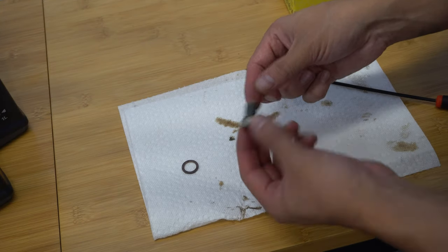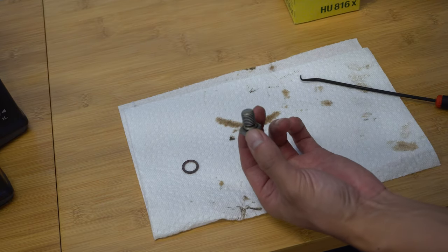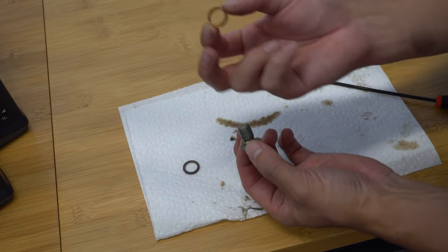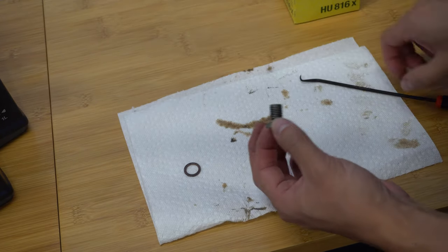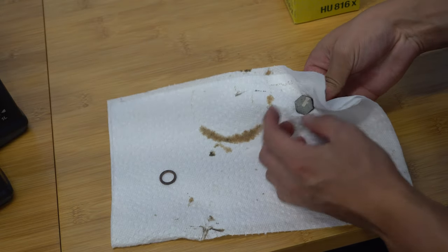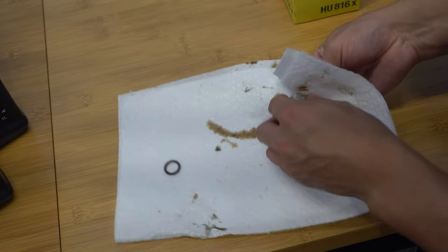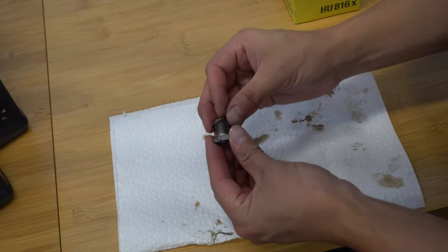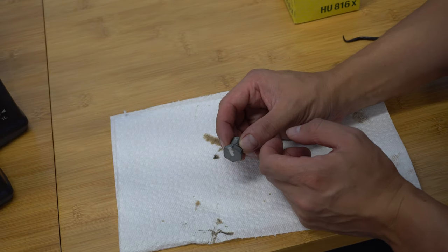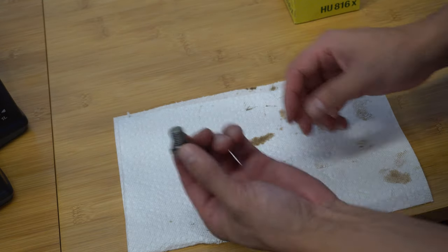So this is our 17 millimeter bolt from the oil pan and as you can see, it does have a crush washer already on it. We're going to go ahead and replace that. If for some reason this doesn't come out with your actual bolt, make sure you grab it out of there before you put the new one in — because if you double up on the washers, it's not going to create the proper seal that you need and you could potentially have some leaks. So go ahead and reuse the bolt, clean it up, put our new crush washer on. There's a little white mark here that'll indicate how much torque I need — it should be 18.4 foot-pounds. So we'll go back into the car and reinstall.